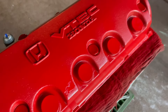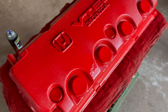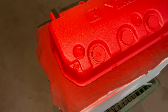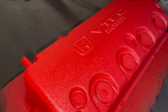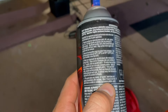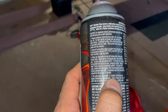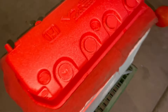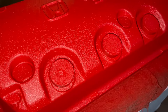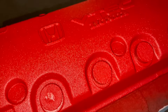Unfortunately this run still looks rough, so I think once it dries I'm gonna sand it down and touch it up with the paint — that should be good, because literally everything else looks so good and it's already taking up that wrinkle finish. This is going to be the fourth and final coat. It's looking pretty sick — you can already start seeing the wrinkle finish happening. The can says allow two hours to air dry; the wrinkle finish does not appear immediately after spraying. And look at that — I think the run is gone! The wrinkle finish covered it up. You can't even really see it anymore.